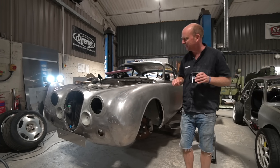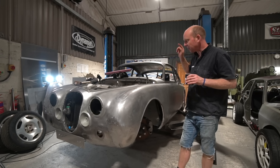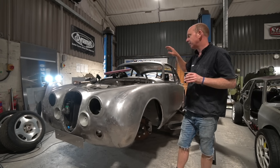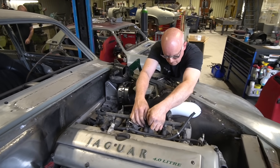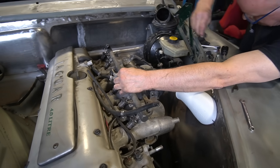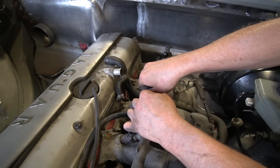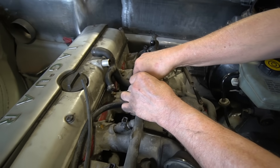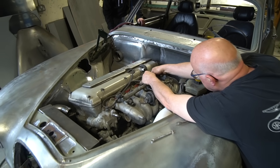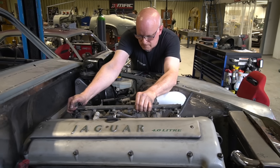On to Churchill Mark II — the Jag two-door coupe. Stu's been busy with a lot of the dry build tasks. He's fitted these rather nice ducts through the inner wing. These are a 3D printed part based on a CAD model done from a scan of the inner wing, so they fit exactly to the inner wing. They're in two halves — one half in the engine bay, one half underneath — and the two halves are screwed together, clamping the inner wing perfectly in between.